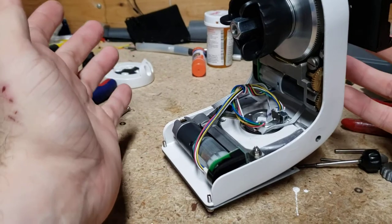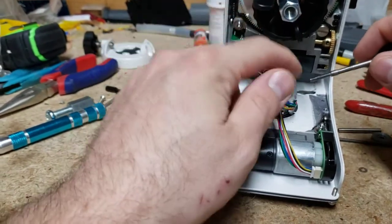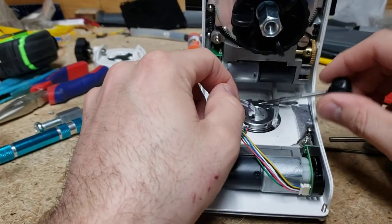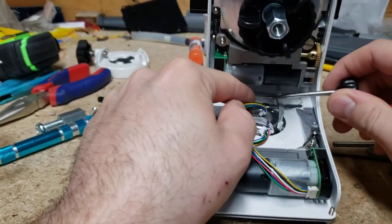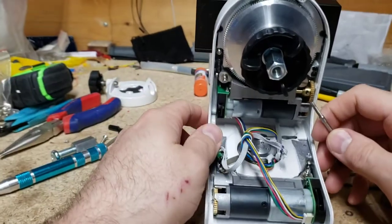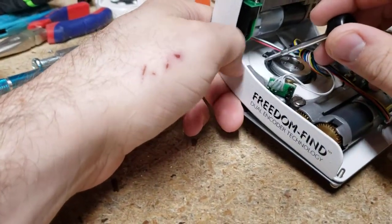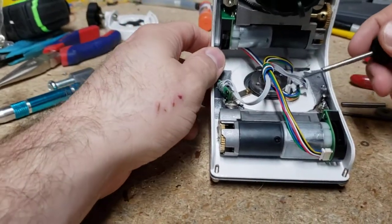Well, if you had the one with the dual encoders, I guess it shouldn't matter that much. I just think it's a terrible design. Well, actually the design is probably pretty good — this is very small, and this piece of metal in here is the actual clutch, which you can kind of see. It's called a collar and it pinches. Basically, this screw has threads on one side and not the other — it's a shoulder bolt. You screw it in and it forces the two sides together by pulling, the shoulder pushes one side, the threads pull the other side, and it pinches the central pivot point. Hopefully that metal in there is better quality. If it stripped out, I could probably dremel out this little point, get a lock nut, and continue using this fix I've developed, which I'm going to go over now.